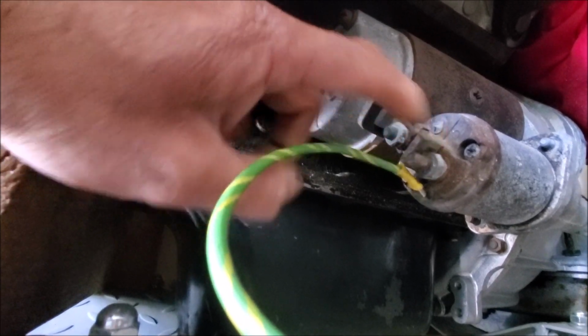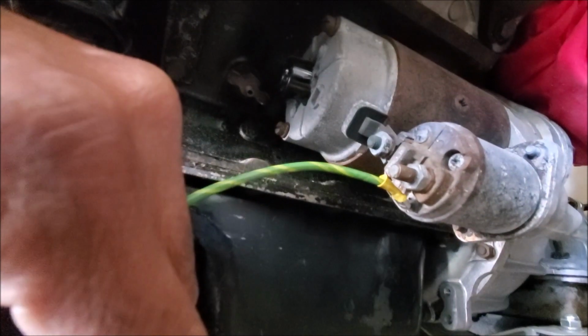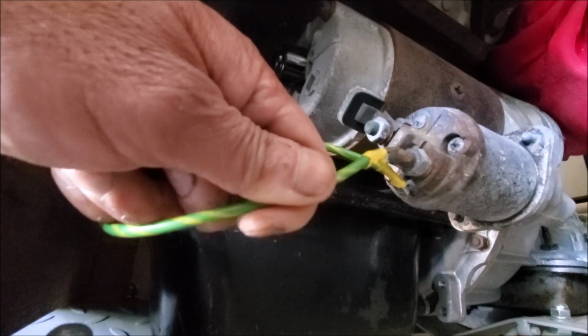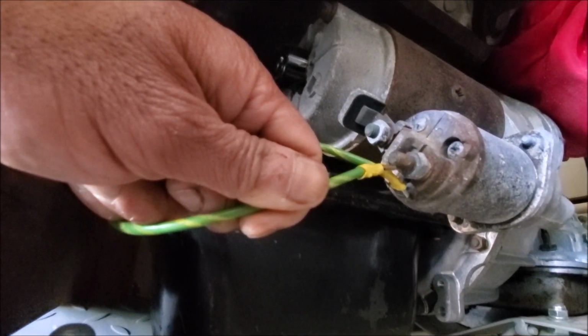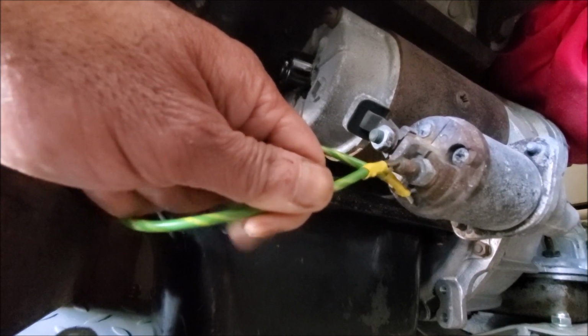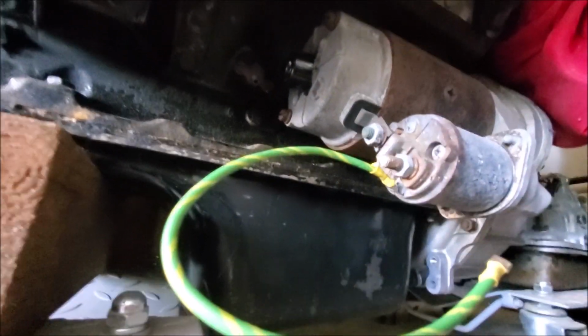Disconnect the battery, do all these experiments I've described, and then connect the battery up. Or if you wanted to, for example, you could disconnect the battery, create a jumper wire, connect this back up, and then be safe at the top of the car, connect your battery terminal to the battery post. If it wants to start, then you know it's a wiring issue between the ignition and this. So some suggestions anyway.